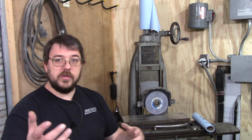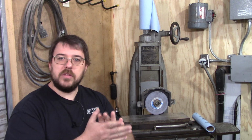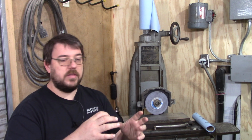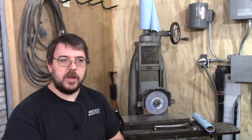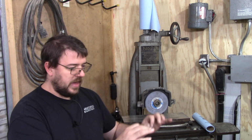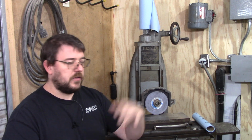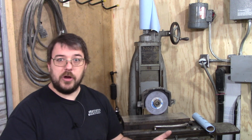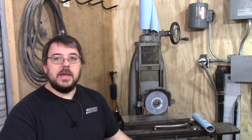And of course, since it's not sitting in the motor, it'll be easy to just add a little bit of weight to the valves if we want to see the effects of that, to simulate different valves that are potentially on the market, and determine with this cam and these valves and these springs, we start getting lift off at 11,000 RPM. These are answers that we'll be able to get exactly, and that'll be wonderful.